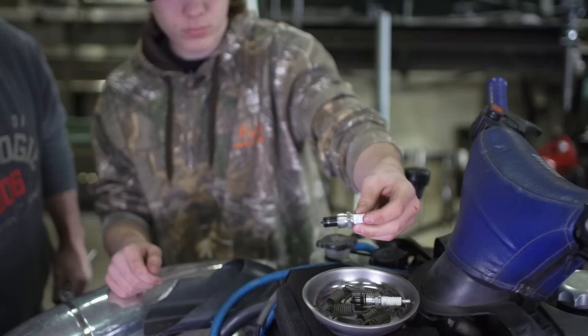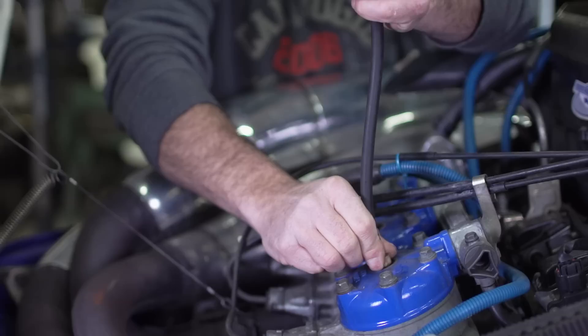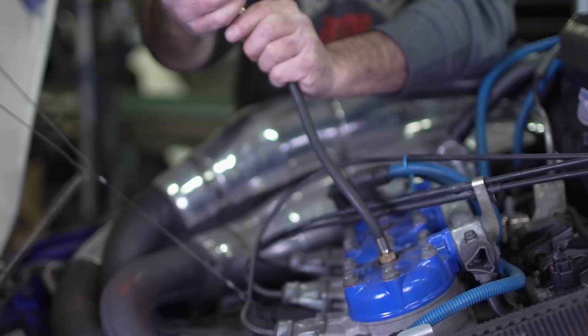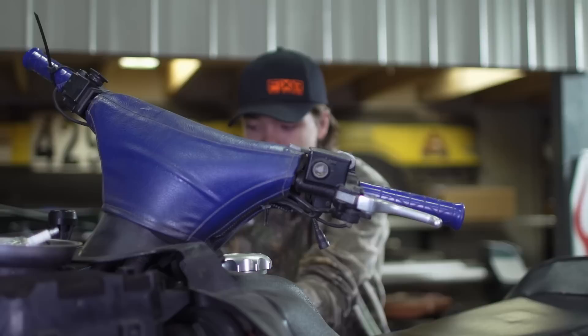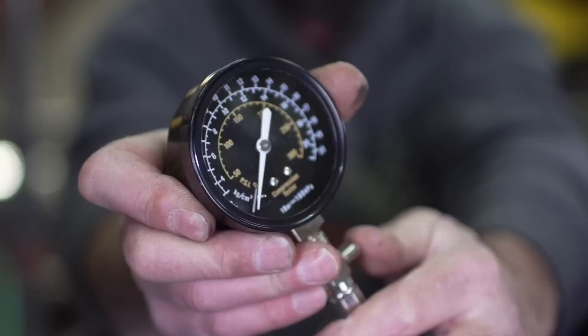I am taking a bit of a chance that the pistons, if they're original, have over 18,000 kilometers on them and are still good and haven't scored the cylinders too much. I won't know that until I'm inside. Instead, I wanted to do just the rings on this machine to show that you can freshen up an engine on a bit more of a budget. As always, I'm starting this job off with a quick compression test on all three cylinders to get a picture of where the engine is at.